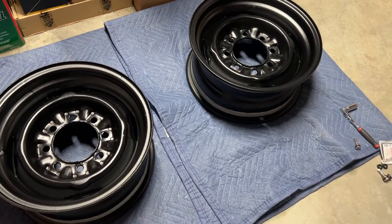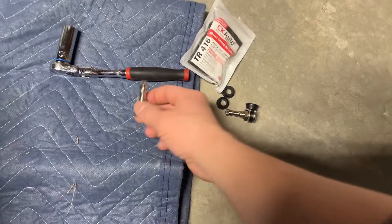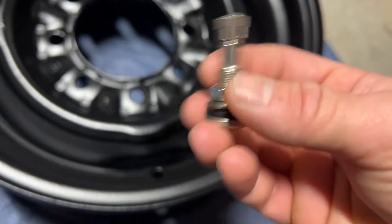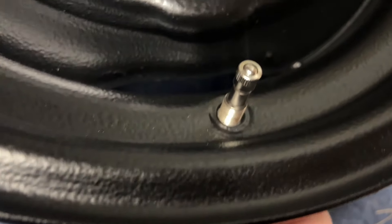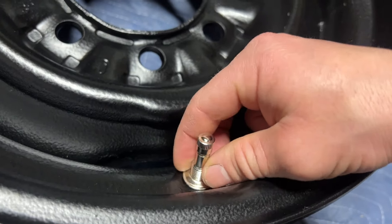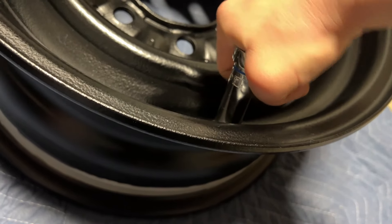It's been about five or six days since I painted these. They've just been sitting in the basement curing — you want to give them a little time before you put the tires back on. I think they look pretty good. Next I'm going to install some new valve stems. I got these on Amazon and they come with two different seals — these use the bigger one. It's pretty simple: just the stem and the seal, then you install it. Make sure that little lip goes in all the way, and install the washer with the convex part facing up, concave facing down, then the little nut. These are just 14 millimeter — snug it up, you don't have to go crazy tight, but you want it snug to the point where you can see the seal smushed.